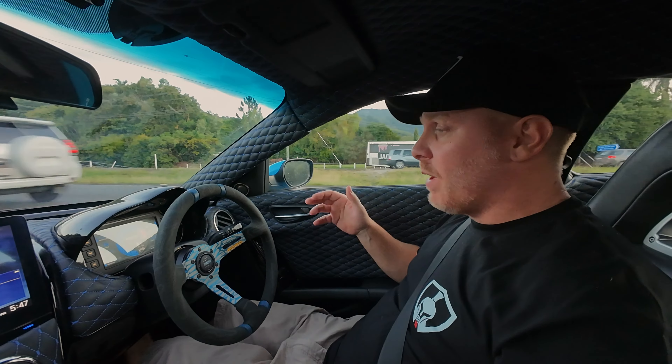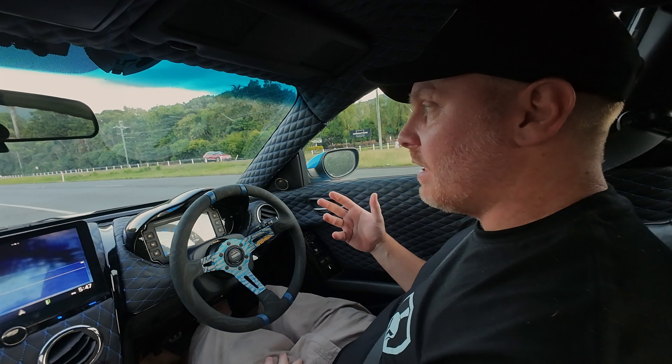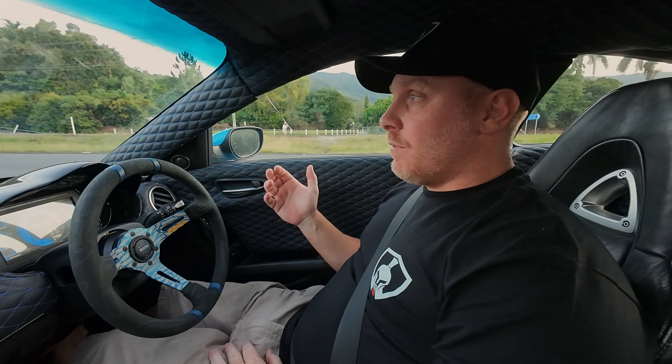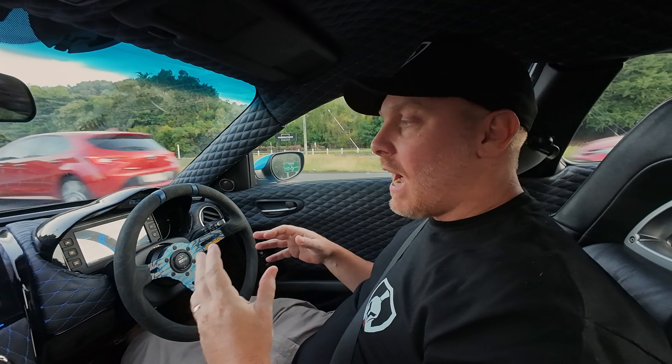We're out on the highway giving the spring hub clutch a good test. I'm going to show you how much movement I have from not engaged to fully engaged, and how rough the take-off is. I've been driving this for a couple of days and for street-type driving it's not really ideal — you're putting a lot of stress on the gearbox, diff, and engine components. You'll see the car shutter as we try to take off because the ceramic material bites so hard, making smooth take-offs almost impossible.